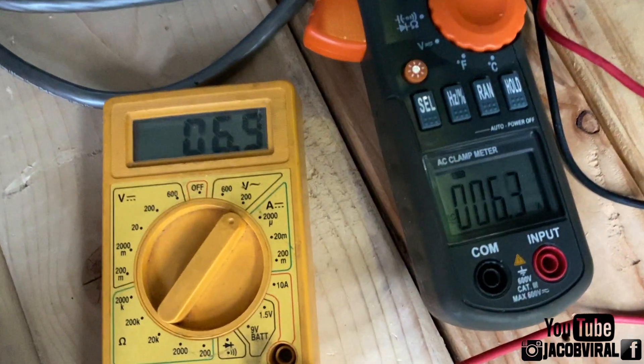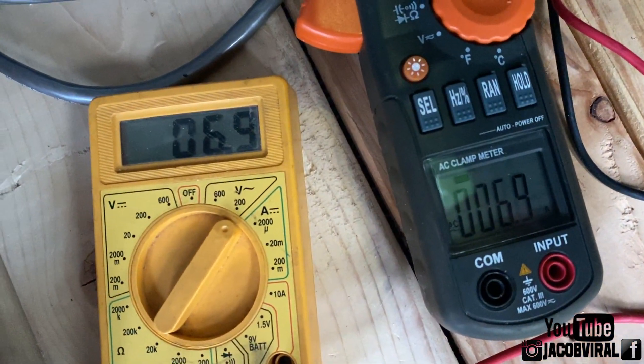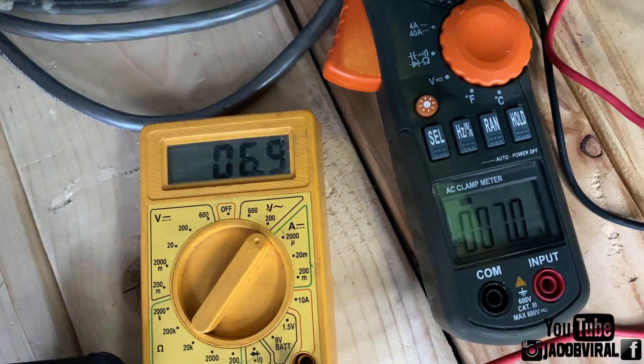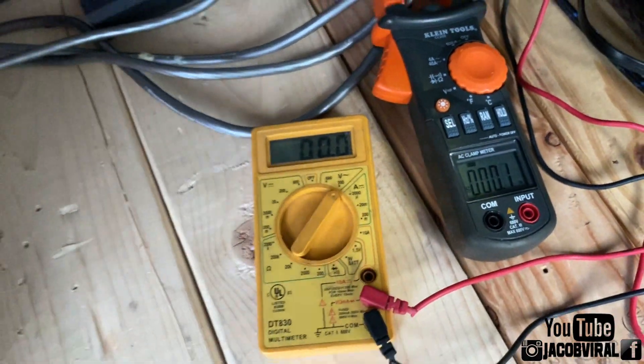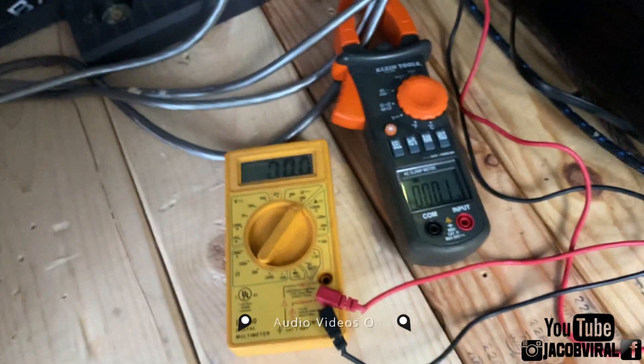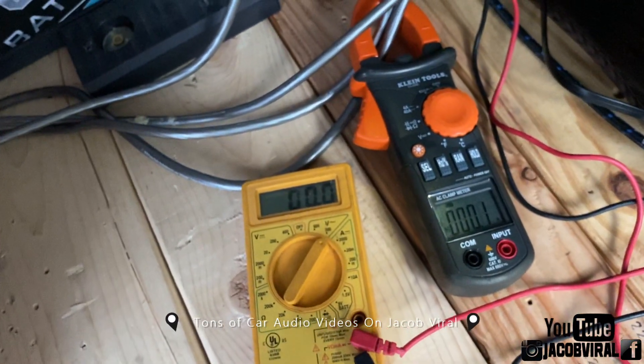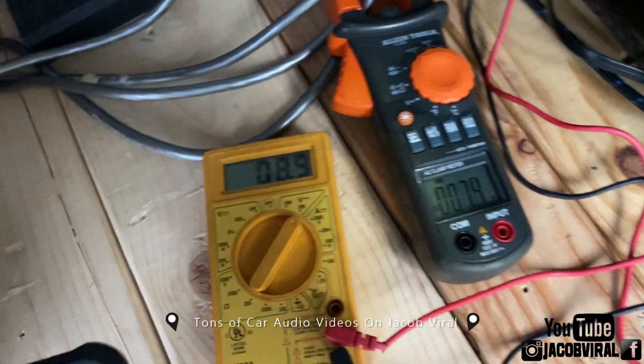Low volume first. Seven times seven — so that's 49 watts. Real power: 49 watts. Sounds low, but that's the power out of the amp right there.